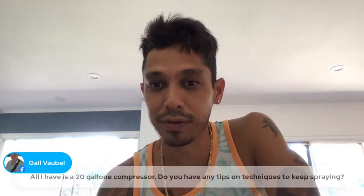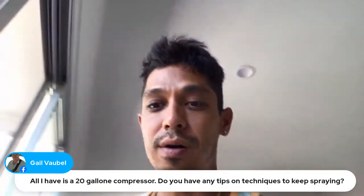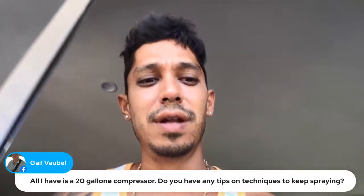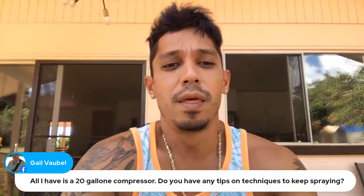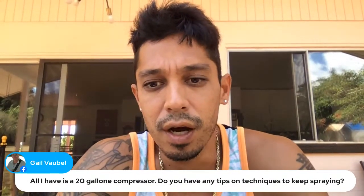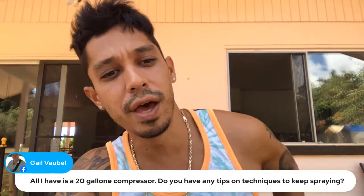And let's do some Q&A. Cam says, hold on, let's get back to Gail here. He's on Facebook. All I have is a 20-gallon compressor. Do you have any tips on techniques to keep spraying? Well, you really can't do much with a 20-gallon compressor because you don't have a lot of volume storage, right? So nothing you can really do besides play catch up with your air compressor. So it's going to be kicking on and off. I wouldn't suggest painting any large projects. You could probably get away doing a hood, a fender, a motorcycle, no problem, parts and all that, no problem.